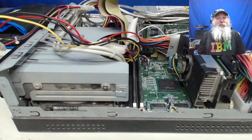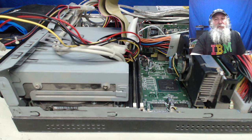Now, one of the more heavy-duty aspects to this is I have to trim away a little bit of metal so I can get a third DIMM in that available socket, increasing the memory of the system. So I'm going to get turned around and go over the items one by one for my end goal of getting this system in a little bit better shape for that retrofit goal and get back in service, being more functional, everything in that nice, tidy, compact package.